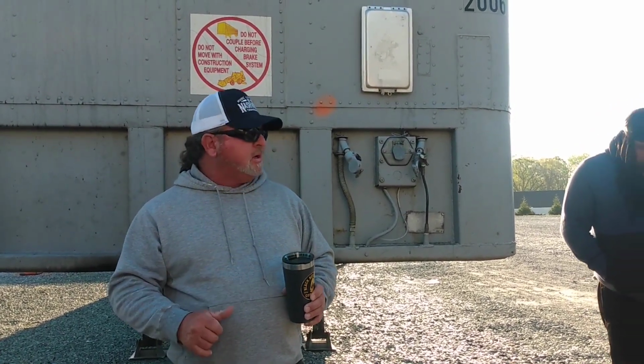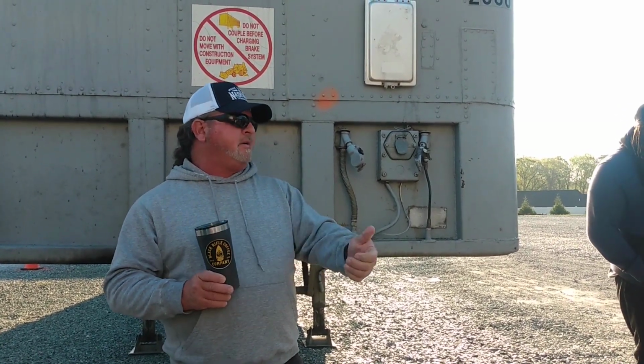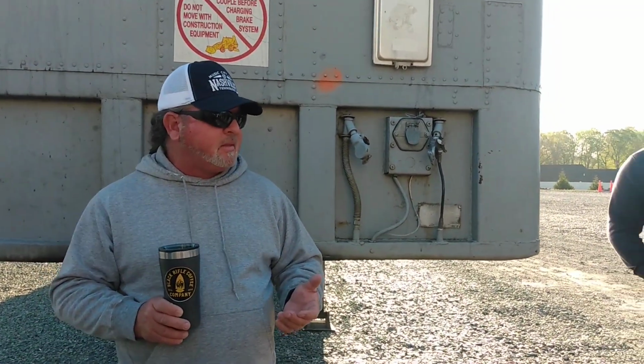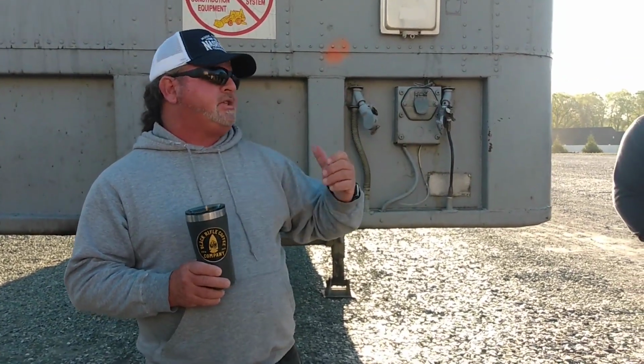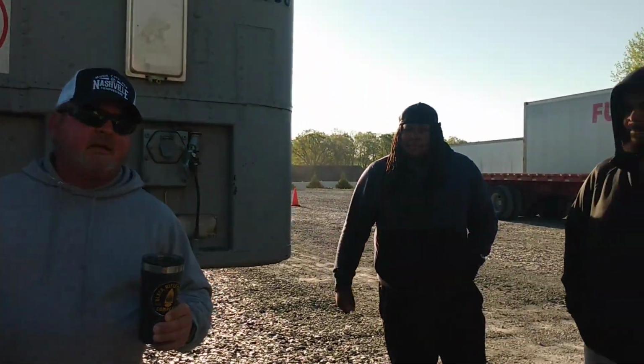CYA starts with you. If there's anything about it that you feel ain't gonna make it, don't pull it. We talked about it earlier. You walk around this thing, you're gonna take that hammer, you're gonna thump every tire. If it don't thump back, don't pull it. If it's got a wire showing, it ain't gonna make it to California, don't pull it. You got oil laying in the bottom of the wheel, you got a leaking hub seal, don't pull it. Anything like that, make sure all your lights are in place as you walk around. I'll get to that in a minute, all right? So, we're gonna say that it's all good. Everybody with me so far? Any questions? All right.